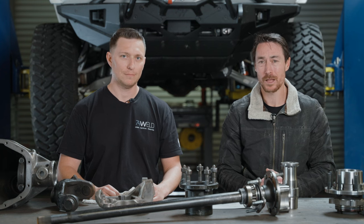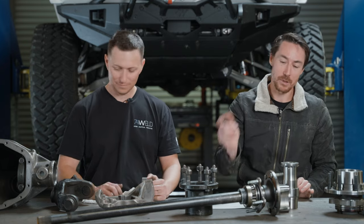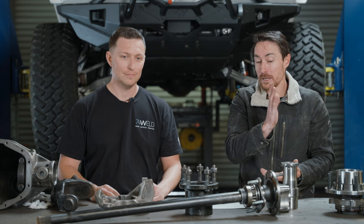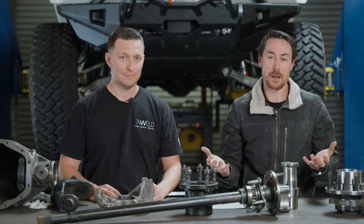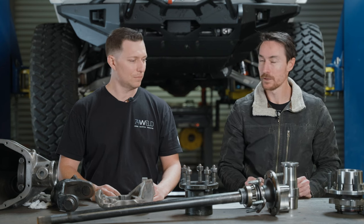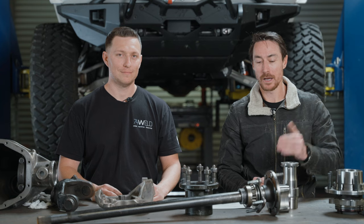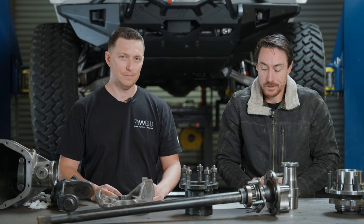Sprinter vans — I see they could really benefit from a portal, but the simple fact is the sprinter van has a lower A-arm and a strut, and that strut is carrying the load or mitigating that torque load at the wheel. I'm not going to build a portal for a sprinter van because it doesn't have an upper A-arm, and I'm not confident it wouldn't just destroy the sheet-metal unibody that is the frame on a sprinter van. I would love to make a portal for a sprinter van, but it's a non-starter — I don't feel the rest of the components can hold up.